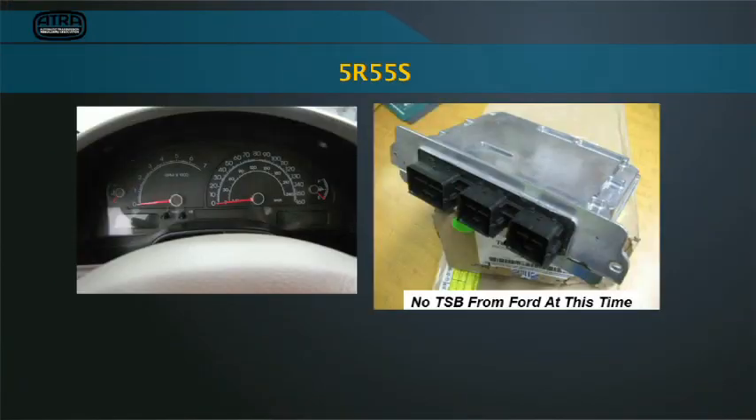One of the things I had one of the guys do was put a pressure gauge on the driver's side line tab — there's one also on the passenger side — but put a pressure gauge on the left, driver's side, right near the linkage, and monitor the line pressure. If it's high, take the handle of a screwdriver, find where the computer is located under the dash, and just lightly tap on the computer body itself. If you see the needle on the gauge flicker up and down as you're tapping on it, I can guarantee you that computer is bad and needs to be replaced.